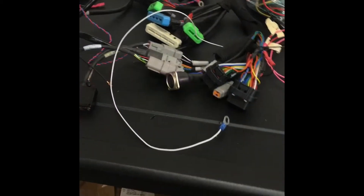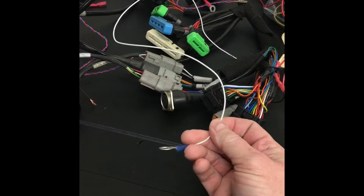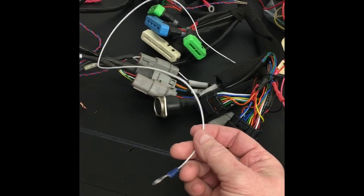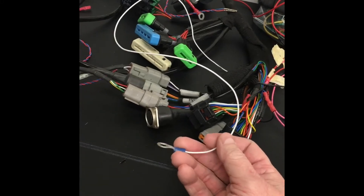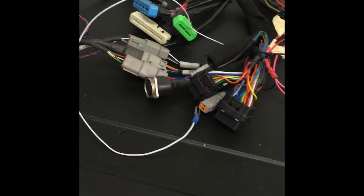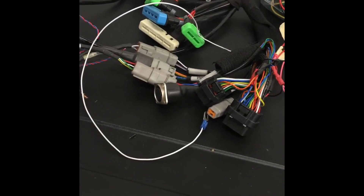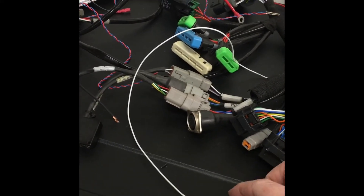This white wire — the mystery wire — I finally figured it out. It was wired to a nine-position MoTeC rotary switch, basically a potentiometer that allows you to hook it to fuel trims, ignition trims, or boost trims. At the turn of a knob you can manipulate the signal that the solenoid, injectors, or ignition uses and scale it without having to interact with the MoTeC via computer. Now that I know what it is I'll be able to use it for something.